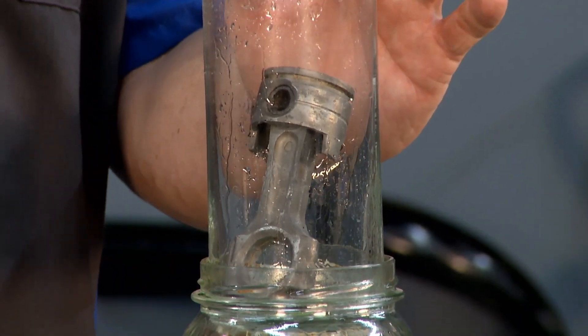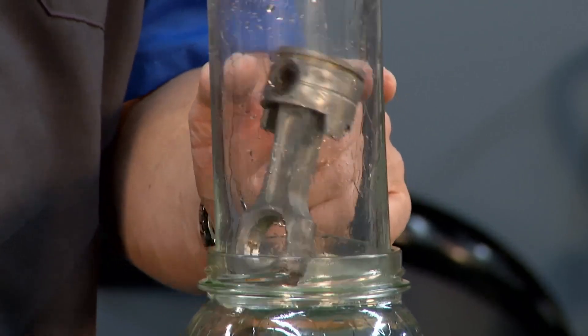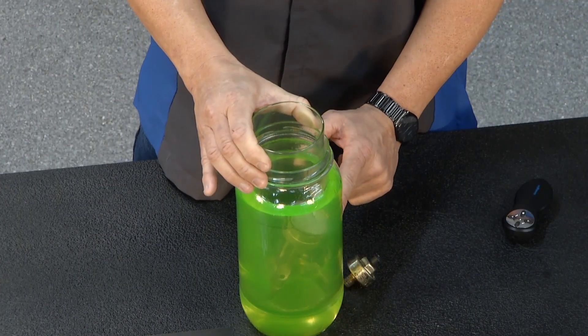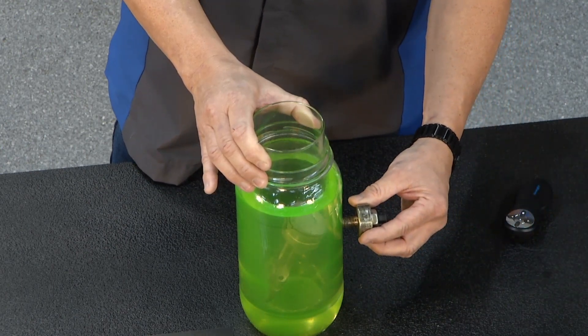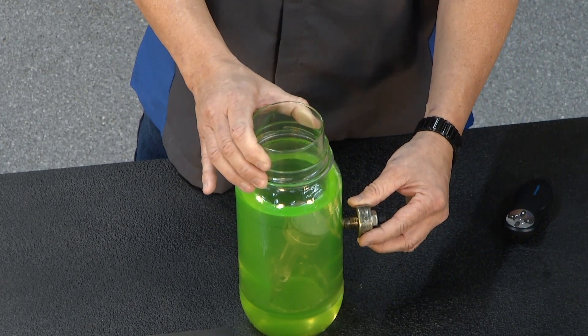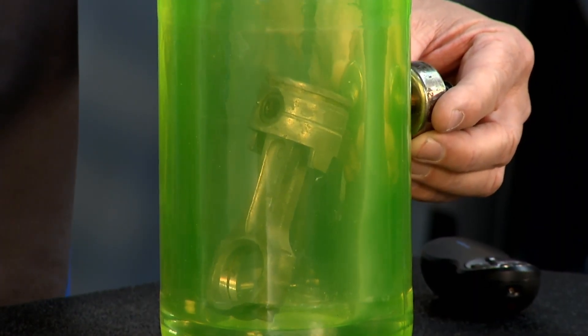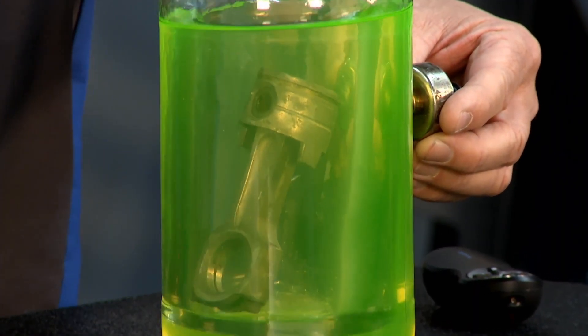When the piston rattles from side to side, that actually causes vibrations inside the coolant. The knock sensor, sitting right there in the coolant jacket, is a piezoelectric generator. It senses that vibration and tells the computer, hey, that piston's rattling. And when that piston's rattling, bam — we retard timing, losing performance. Not a good thing.